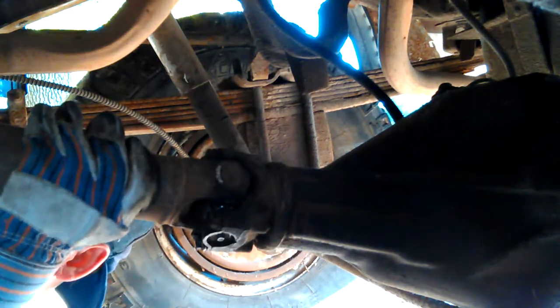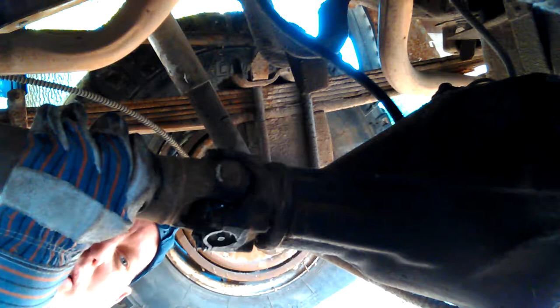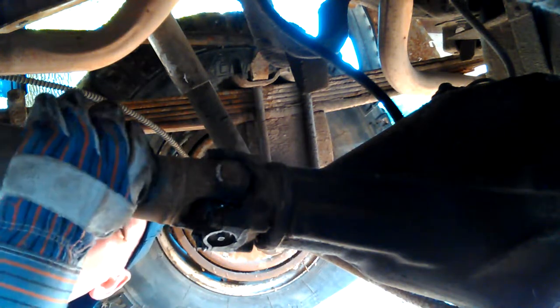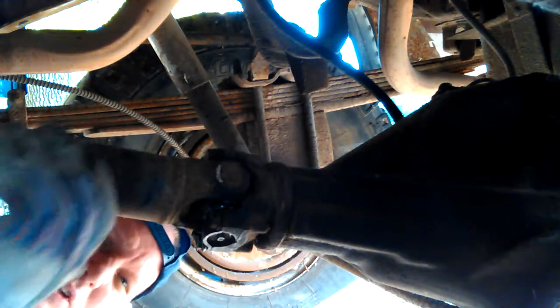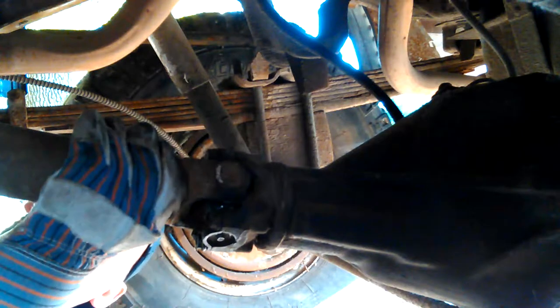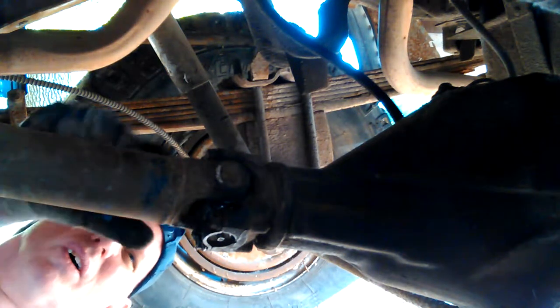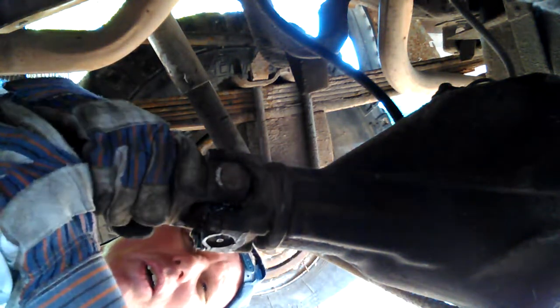I put it in neutral, but it still doesn't go anywhere — that's good though, because it's good that I can get to it. It kept coming out of that other one so much and so fast that it kind of worries me as to what kind of shape that U-joint is in, this one right here. I'm glad I did that for finding that out, and I'm sure it needed grease. Yeah, I see some coming out this back one — that's what I was looking for. So it went all the way through it. I'm going to test drive it after this. Then I'll get back under here and see. It'll fool you — you'll think it's not moving, but there's a little slop in the differential, so it makes it even harder to tell if your U-joints are moving.